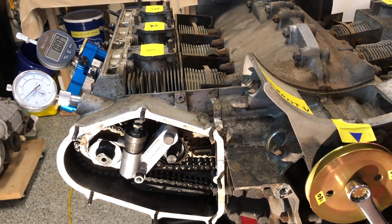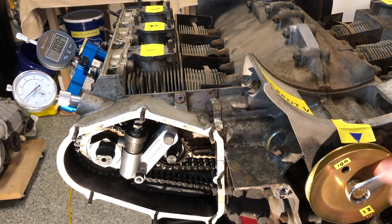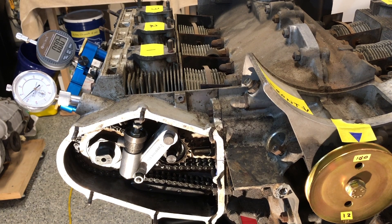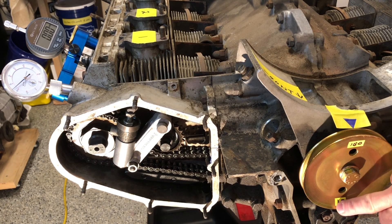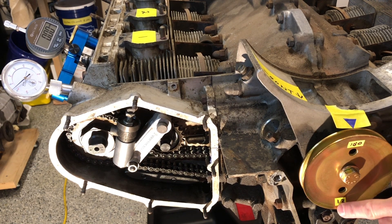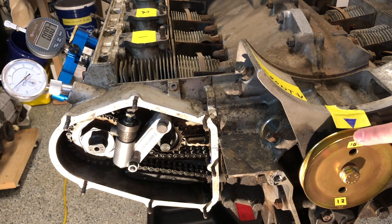Keep an eye on the gauge as we go through the rotation. The first 180 degrees — nothing has happened with our valves. First stroke is complete. Now from 180 to 360 degrees is where all our cam overlap business takes place — this is really the most important part of cam timing. We've hit bottom dead center at the end of the power stroke and now we're coming up on the exhaust stroke. As we approach top dead center we're going to be in valve overlap.